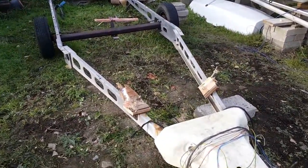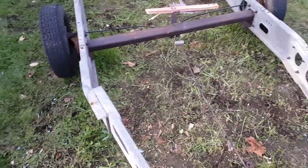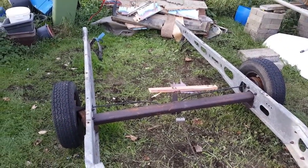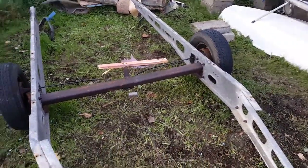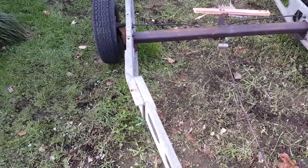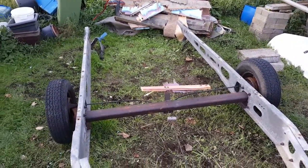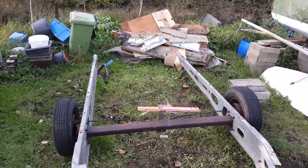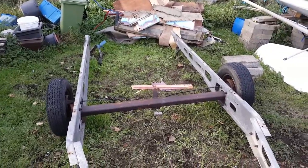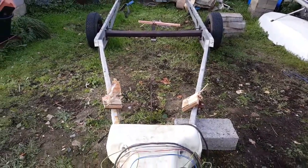So it's kind of bolted together, the two sections, the front section, the rear section, so I'm going to strengthen that all up with pieces welded in and bridge these bolted sections here with steel and weld it in place, and then make up a structure here in the back as well. I'm not 100% sure I'm going to do it, but I was going to have to square that and put in some kind of bracing as well. So, but that's the demolition phase pretty much over.